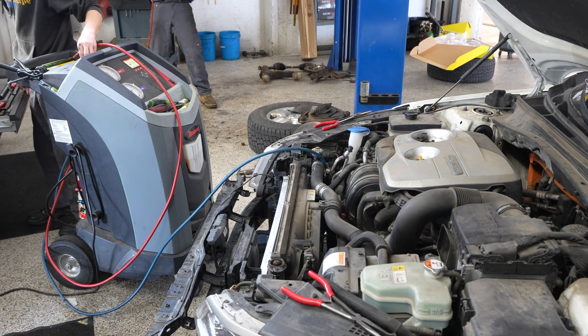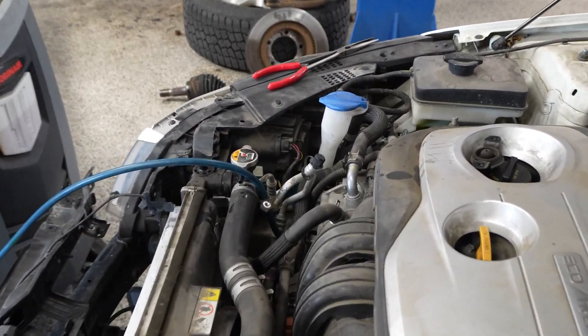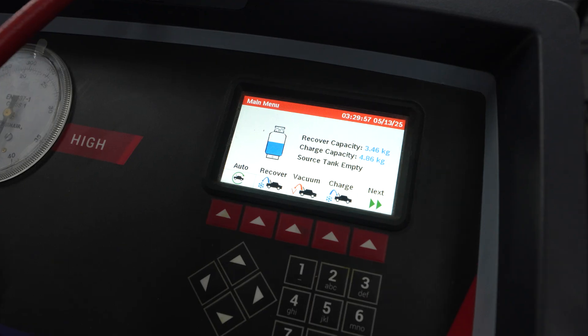Fast forward to the newer cars — we're now on a Freon called R1234YF. Very expensive Freon, very expensive machine, very slow process. Do not touch these vehicles. It's very easy to contaminate them. They don't hold a lot of Freon, everything has to be measured perfectly and done properly. If you've got a 10-year-old or newer vehicle, you're likely running R1234YF, and I don't think you can even buy it across the counter.